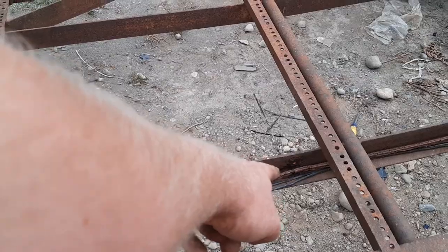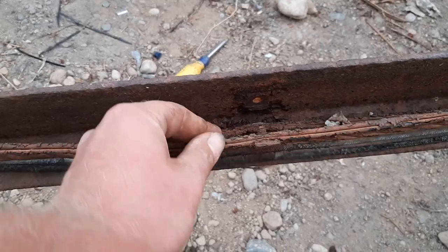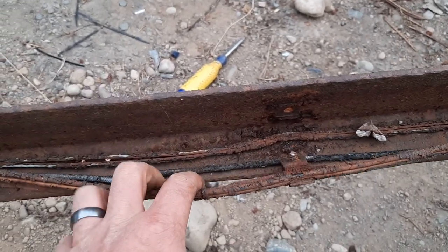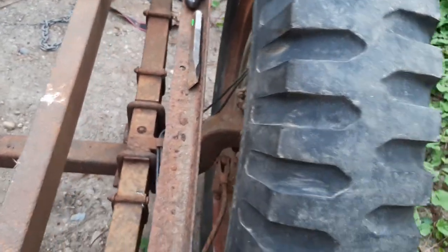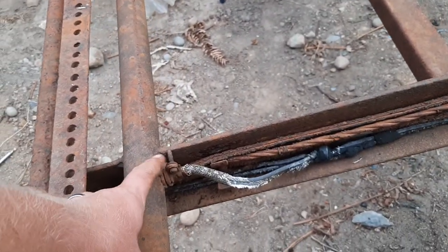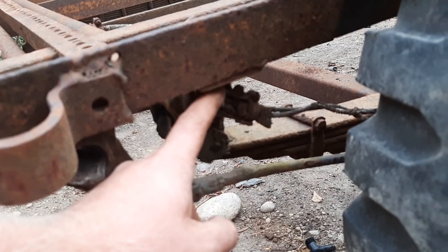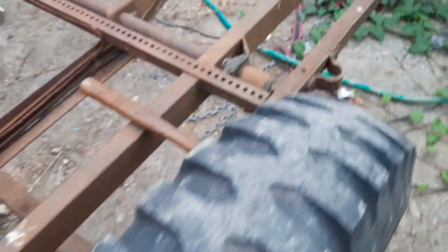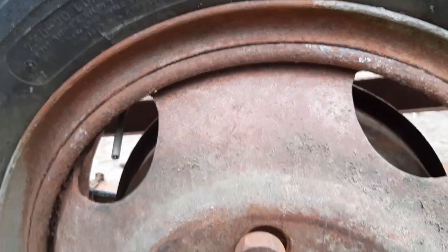I started knocking out some clamps that were on this — there's just no way this is gonna get pulled apart. Some of that wiring is in good shape, but this wiring is just cooked. Kind of interesting how this trailer got electric brakes and manual brakes. You can see this rod driven down the rod. They used almost like a Romex connector down to another electrical connector to route the wiring for the brakes, rather than going through the axle shaft like on a lot of modern trailers.